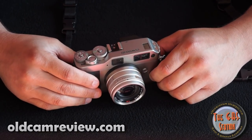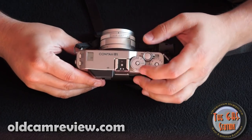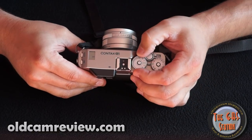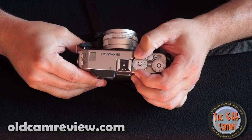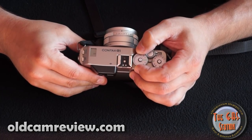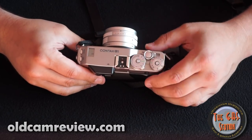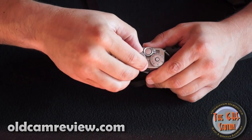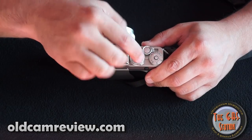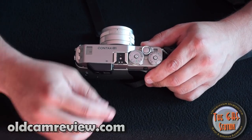It is a DX film camera — 35mm. The controls are laid out pretty nicely. In auto mode or aperture priority mode, it gives you exposure compensation on this dial right here. It moves pretty nicely and there's a little extra heavy detent when you put it in the full auto mode. You can use the exposure compensation here. If you want to switch to full manual, you put it towards the end of your exposure compensation dial, push the button in the middle, and then you can change your shutter speed. It reads up to one two-thousandths of a second.